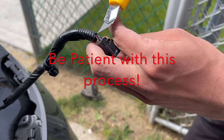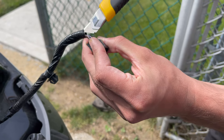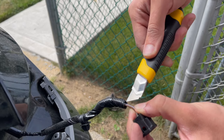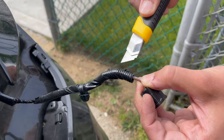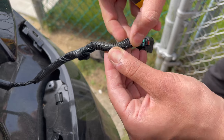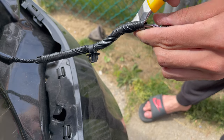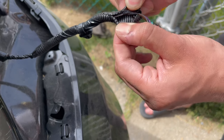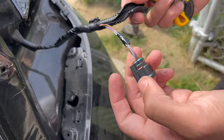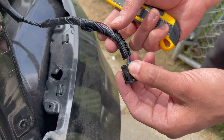Take this piece and be careful when you cut — keep the wires down and cut upwards so you don't cut the wires. Hold the wires, keep doing that — it gets easier as you go. Take this off, pretty much as much as needed right there. You can leave it like that or cut it off — when you're done, put the wires back in and re-tape it with electrical tape.